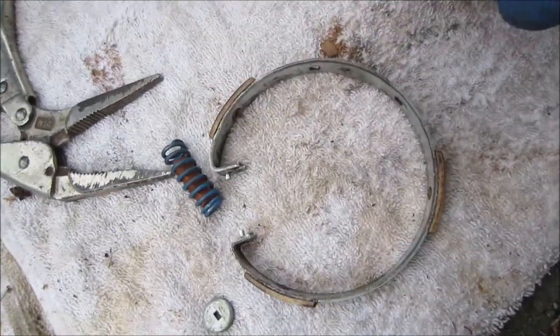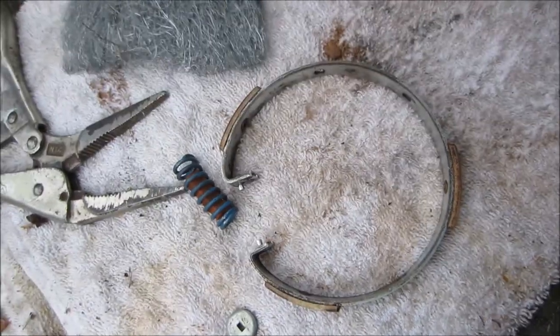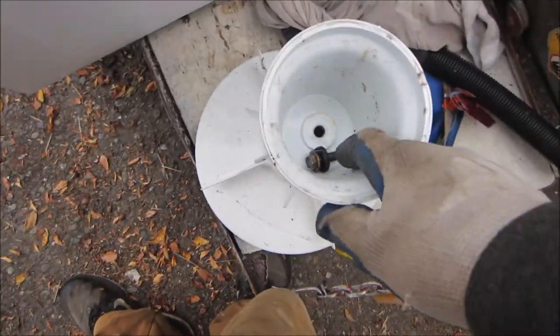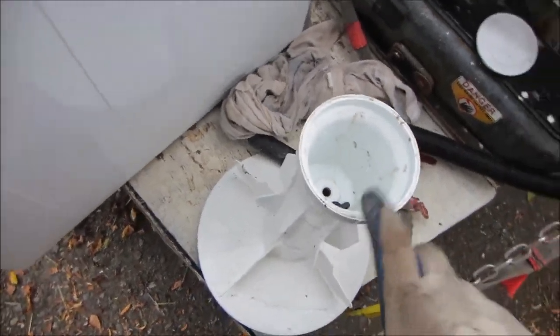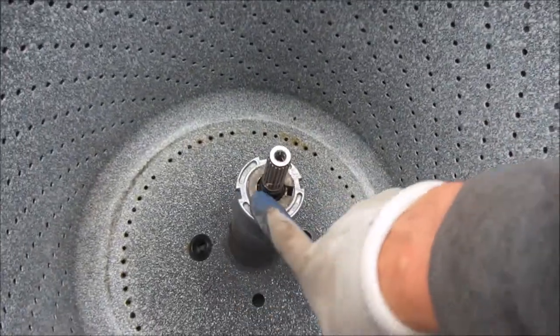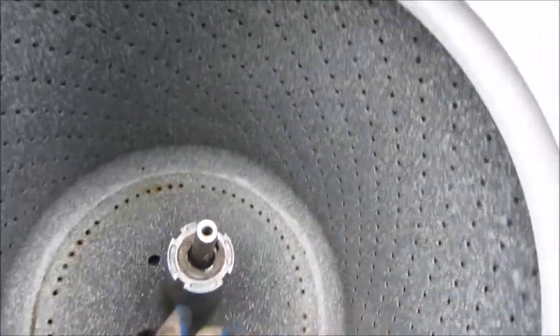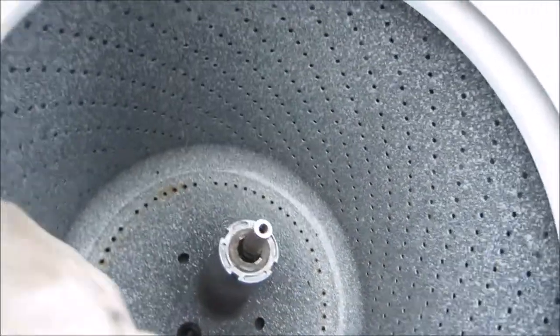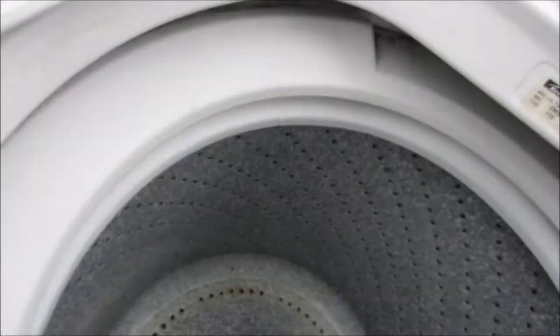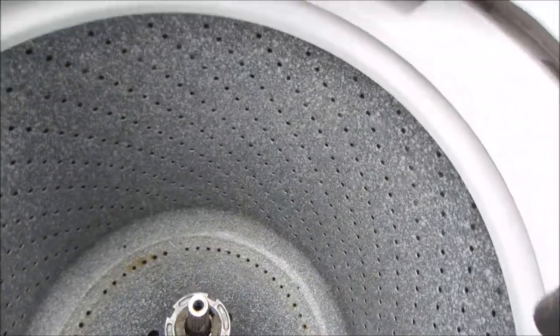That's your tip for today. If you need any help you can contact me at 707-443-8347 — I give phone advice for $25. Now pull the agitator off — normally you have a 7/16th nut here, though some are a little different. On the typical direct drive Kenmore it's like this. Check your collar — if it looks good and intact and not falling down, check your basket. Make sure there's no slop. The double-ratcheting agitators will make noise, and yes, that's normal for an older machine.